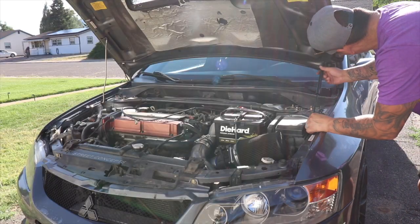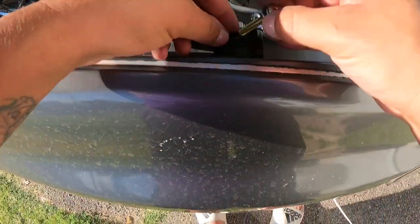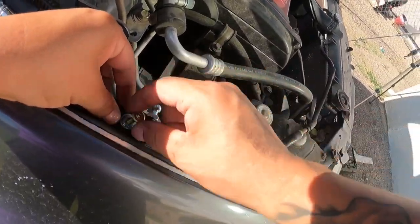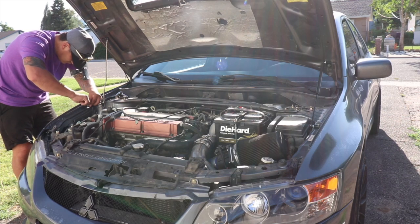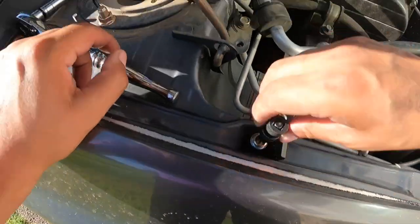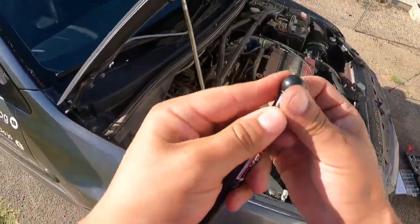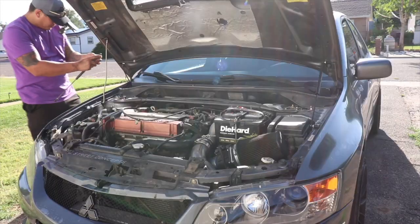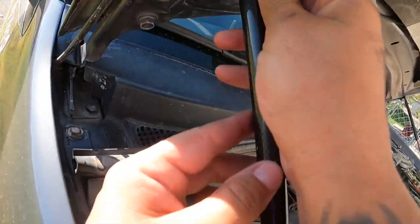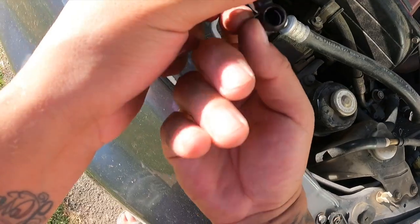Put the rubber shim in, then screw the mount in by hand. Make sure that the fender mount is pointed down and in — not upward like the one on the hood — because the strut extension will be fully extended that way. If you turn it the other direction it'll have tension and just won't work as well. Grab the carbon fiber strut, remove the little pin, snap it onto the tube, and do the same on the bottom.